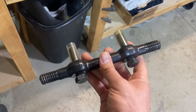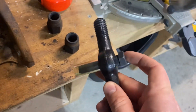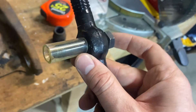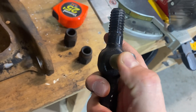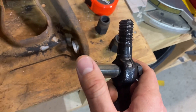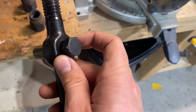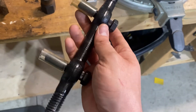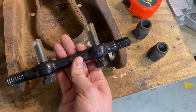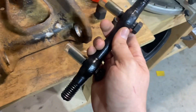To make it easier to get a measurement, and because you'll have to do it anyway when you go to spin these — they are like a press-in fitting, kind of like a wheel stud — go ahead and put a nut on, set it on something, and hammer it to knock these out. Then just put the rubber sheeting back on so you don't lose the bolts. You will have to knock these out and knock them back in when done, so that you can spin these around. If the studs are hooked up in here and you want to spin it, the studs would hit and prevent you from getting adjustments.